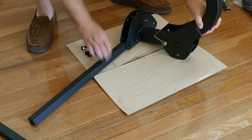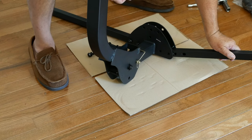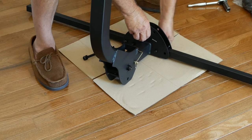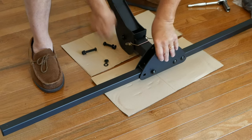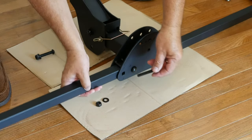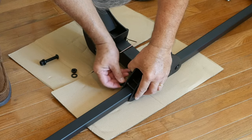As we repeat for the other side, take note of the horizontal hold-down pins between the two halves inside the connecting bracket. You can see how the horizontal tube slides in under these pins. Here is a good video shot of those pins. Again, you want to make sure the heads on the carriage bolts seat flat into the square openings before tightening.